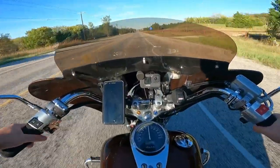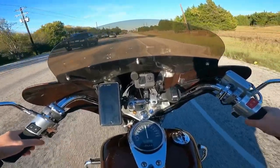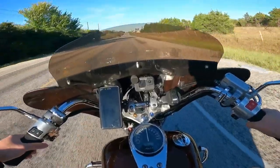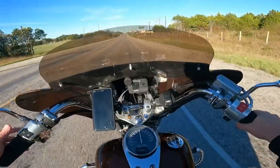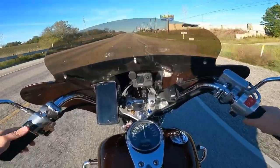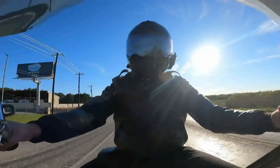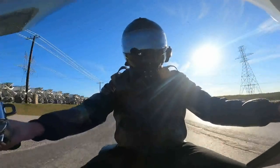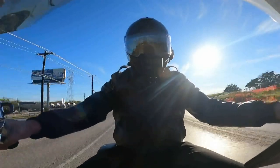So one of the things that I noticed early on is that I was getting kind of inconsistent fuel numbers. And after a while, I realized that there were air pockets within the tank itself, which, prior to that, just riding in a car, you don't think about, preventing a tank from being completely filled up whenever you go to fill up. But that, combined with the heat of the engine underneath the tank, can sometimes do some funny things with your fuel range itself.